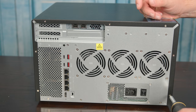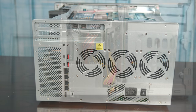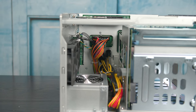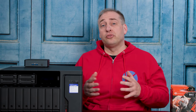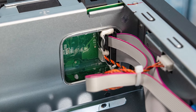Opening up the system, basically the entire top just comes off — there are a couple of screws, but you're really not going to be going inside your NAS that many times. The first thing you notice is that there's actually a lot of empty space. You can see the power supply, and it looks like it actually has PCIe power. You can also see the 10GBase-T card coming out of what would basically be the bottom of the motherboard — an interesting orientation. QNAP is really using both sides of the motherboard, I think to improve airflow, and they were able to design a custom motherboard and custom PCB for this, which gives some really nice customizations you don't get with a standard off-the-shelf motherboard.